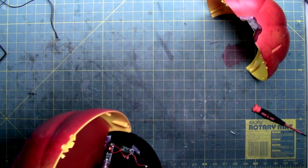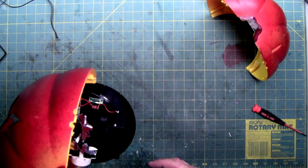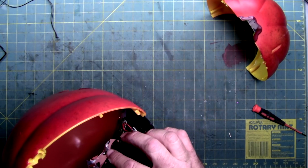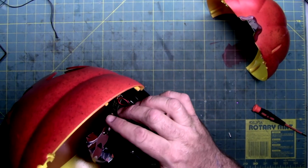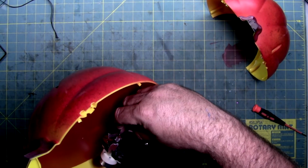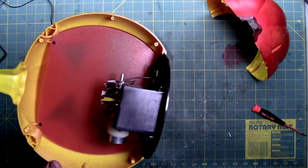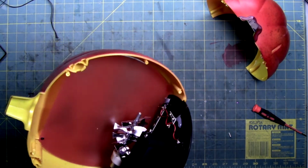There's the mechanism. Wow. I haven't seen a mechanism like this in real life, only on other videos. How it works: the motor spins the shaft, which has these cut pieces of, feels like mylar, that are just pushed over the shaft at an angle, so they're wedged. Basically, the notch is smaller than the shaft, and when you push it on, they twist sideways to keep under tension. When the motor spins this shaft, the light, which are those 3 lights right there, reflect off of these curved shaped aluminum flames, and then it reflects it onto the opaque orange plastic.